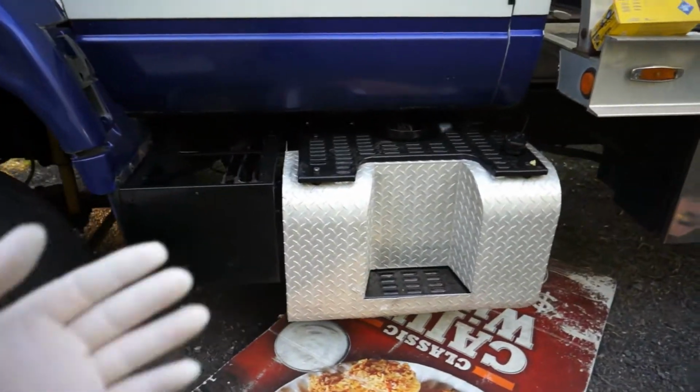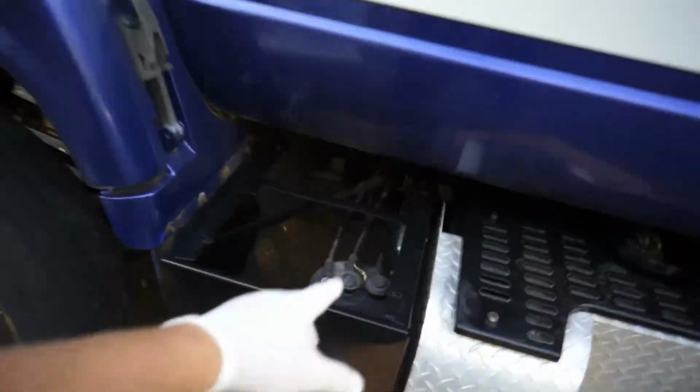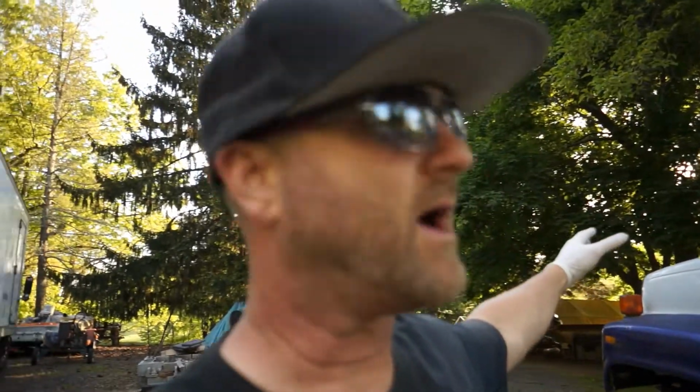Next, I'm just going to drop this big tank, take the tank out, disconnect the wires from this fuel pump, and go back to a stock fuel pump that's pumping out enough to run this throttle body injection on this truck. I had one plan, but nobody at Criswell Chevrolet could tell me, so I had to dig into it a little further and figure it out on my own: these trucks need about 32 to 40 psi of fuel pressure. On the videos you watch online, everyone's like, oh, 9 to 14, 9 to 13 is perfect. No, that's certain years. 94, 95, they had higher fuel pressure. After those years, they went down in fuel pressure because they started changing up the injectors and the regulators started working and all that good stuff.